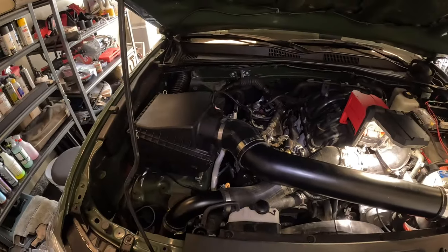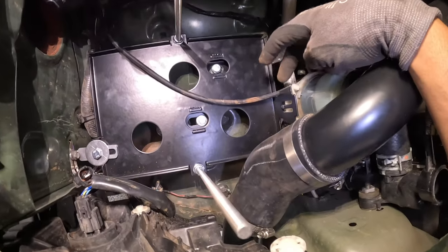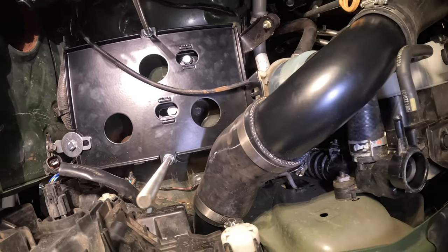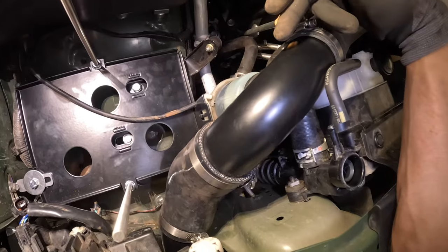Next thing is the battery relocation. I'll set it up and see how it fits and where I need to adjust the power steering. Honestly, that was probably the most frustrating portion of this install so far. I got it in — you use two bolts and there's a clip where the power steering slides into. You take off the factory bracket holding the power steering to the fender well and slide it onto this new one. The biggest headache was trying to get the battery onto the tray with everything in the way.